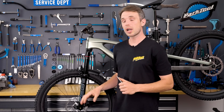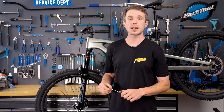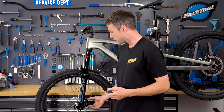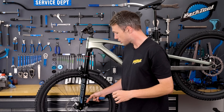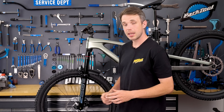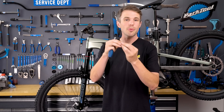If you try and bend it too much you're only going to damage it in the long run. Once you're happy with the placement of the caliper, you can go and do these bolts up nice and tight. If you're unsure what that should be, please check the manufacturer's recommendation and use a torque wrench. If you find that as you're doing up these bolts the caliper is moving or migrating to one side or the other, it can be worth making sure that you have a washer between the bolt head and the caliper. And if you've got any of those conical washers found on some adapters, adding a spot of grease between them helps them slide on one another, stops them binding, and stops them dragging over the caliper. But that's it really — that's lining up your caliper. It can have a huge effect on performance and it's worth getting right.